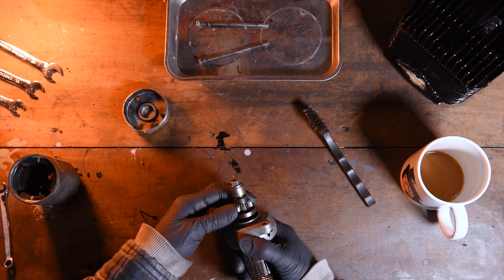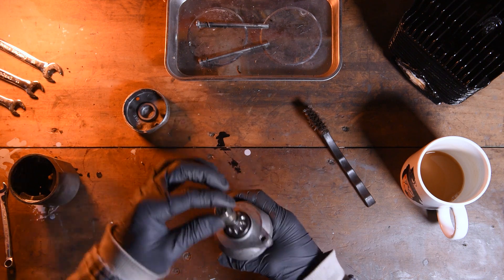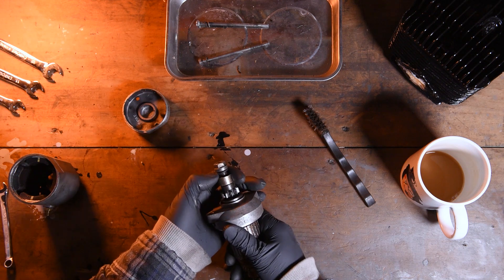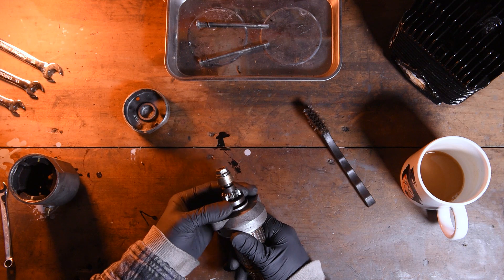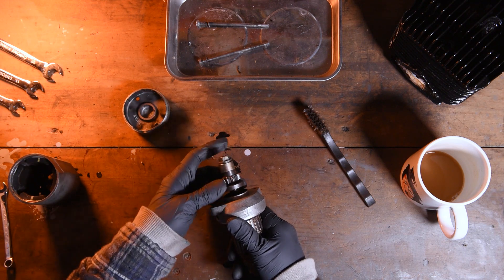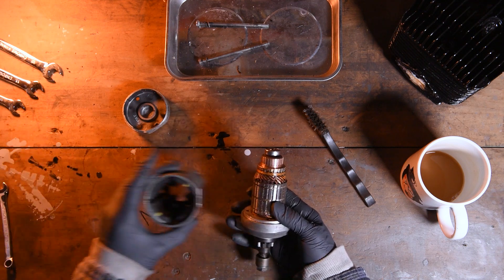If these teeth are too far gone you'll need to replace this bit. On this starter motor there's a nut on the front you can undo and then remove that piece. Currently I do have an o-ring underneath this bushing that is perished, but I'm going to do that once it's back on the paramotor so I can lock this gear into place and then use a spanner to take this nut off. Now that we're done with that we can set that aside and then clean up our main casing.